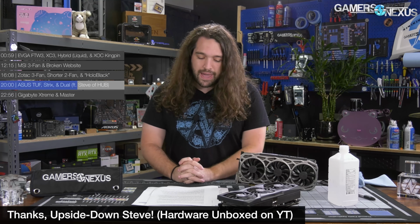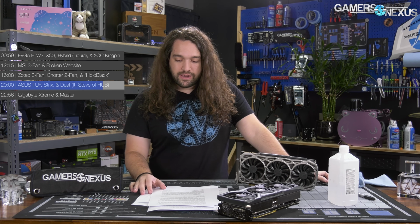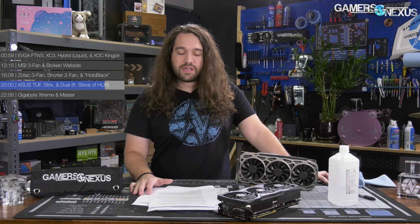And that takes care of that. We noticed that the back plates and the PCBs on these cards also don't extend to meet the full shroud width, so this allows for some room for air to blow through the heatsink. Again, we're going to keep saying this, but that is not new. It's not unique. NVIDIA didn't invent it. We've reviewed plenty of cards in the past that have fins which extend past the PCB and fans that blow through them. Now, a lot of the time, the thing we've most often talked about is when the companies will still leave the back plate obstructing that air. So it's like you just throw away the whole reason you do that design. But it seems like NVIDIA's maybe had a hand in telling the companies, hey, you should do this thing, because they're all talking about it this time.